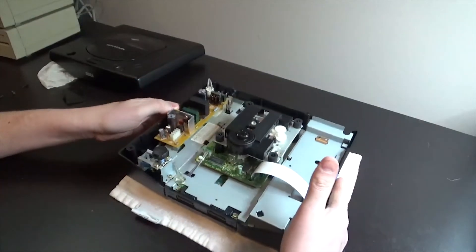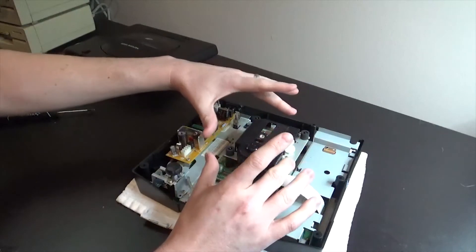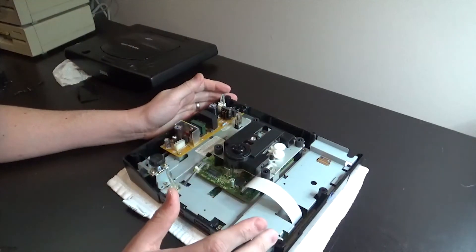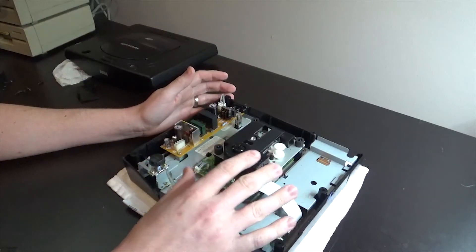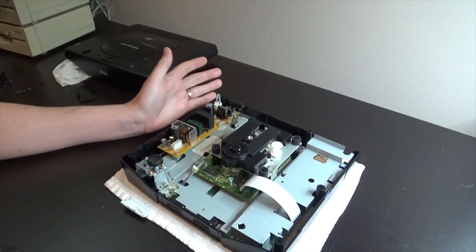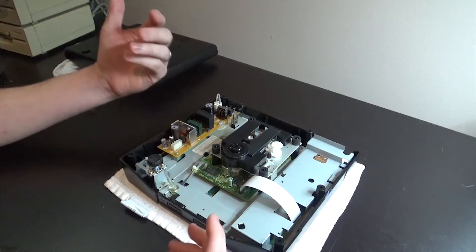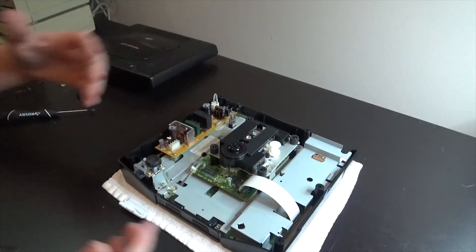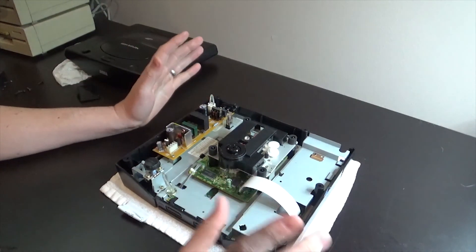That's pretty simple on the inside — not a whole lot you need to worry about, unless you wanted to replace the optical unit with a Phoebe or a similar device, where you actually take the whole thing out, unplug the wires, and put in a module that reads all your games off an SD card. It's something to think about. As consoles get older, optical drives fail and media starts to fail. There are replacements out there that still allow you to play on original hardware, just with a different data entry device — SD cards instead of optical disks. I have no intention of doing that with this unit; it's been working great and I'm going to ride it out. Personally, I like to use games on actual hardware and actual media. Rarely do I do emulation. The only substitution I've made is in the Commodore and Apple II world — I do have a floppy emu and a Pi 1541, just because it's easier than handling five-and-a-quarter floppy disks. But that's for another video.